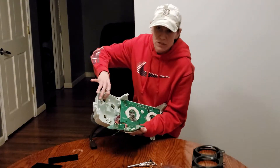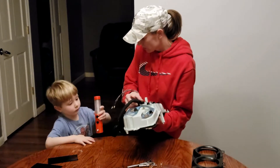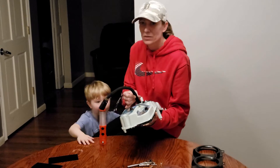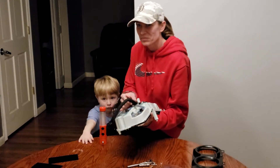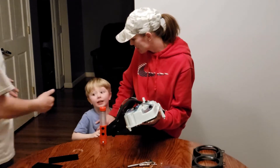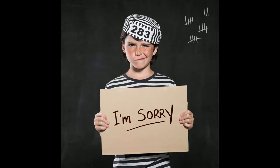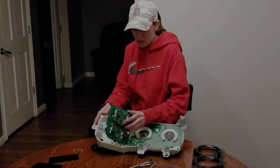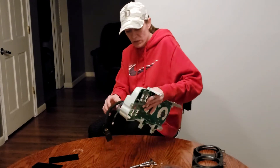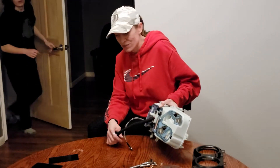There are two bosses on here that need to be cut — I'll show them in the video. You want to bring all the wires to the back. Got all the wires on the gauges — you're going to want to tie them together and bring them out the back. You want to splice the powers together and splice the grounds.